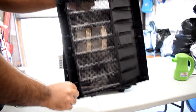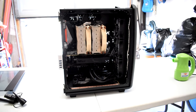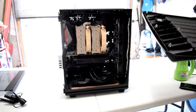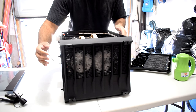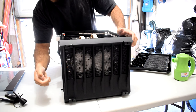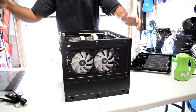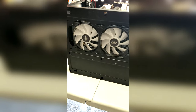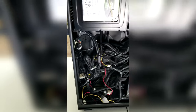To start off, what I did was take off all the exterior panels off of my case. This way I can separately clean the mesh panel since that is where I noticed a lot of the dust accumulating, allowing me to thoroughly clean them off with direct access to blow dust from both sides of the panel. This will also allow me to reach the fans more easily and the inside of my case. As you guys can see as I'm taking the panels off, there is quite a bit of dust on the mesh portions — which tells us the case is doing its job preventing most of the dust from going inside. But there was also a decent amount of dust resting on the case fans, the graphics card, the CPU heatsink, the motherboard, and even the power supply in the back, and we definitely don't want that.